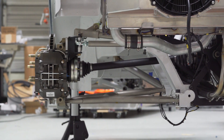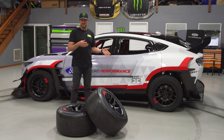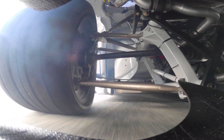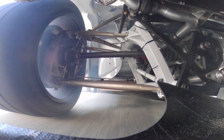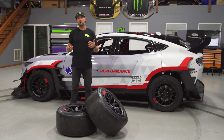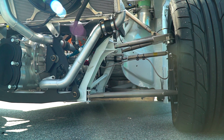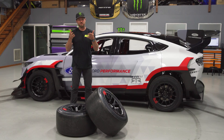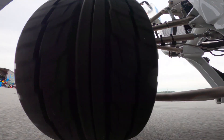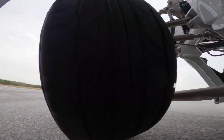The rear of the car stays the same between drift and road race setups — some sway bar changes and a couple damping changes — but in the front we actually have a completely separate set of front control arms and steering arms that we swap out. In all-wheel drive, the steering arms only allow so much angle to make sure we stay within the ranges the CVs were designed to work in. When we go to rear-wheel drive we pull the front axles out, leave the cups in, and change our lower control arms, steering pickup points, and tie rods, which allows the car to have a massive amount of steering angle — a little over 60 degrees.